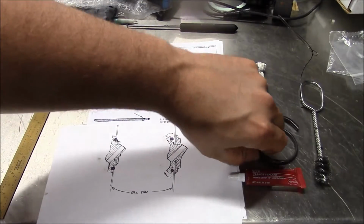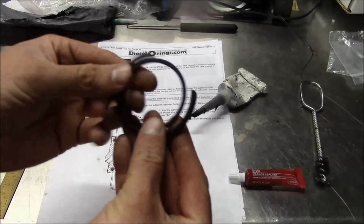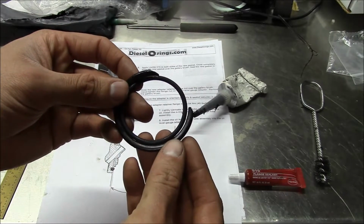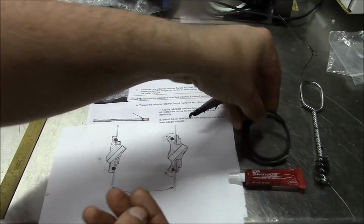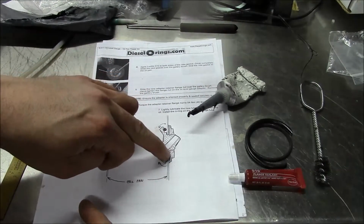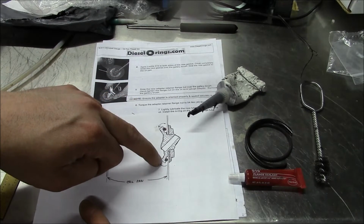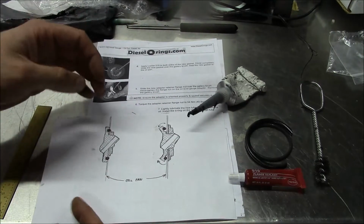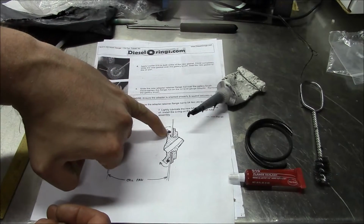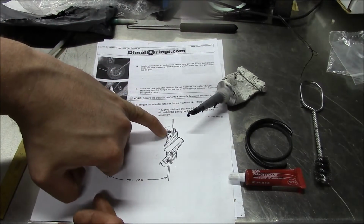And you can see, that's the original O-ring that's split, and it's actually swollen, twice the diameter of the new O-ring. So I don't know if someone tried to over-tighten this nut, or if the swelling of the O-ring caused this to happen. I can't say, but that's the reason I did not install the new O-ring, is because this flange is bent out so badly.